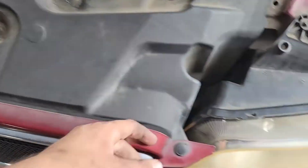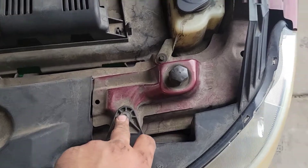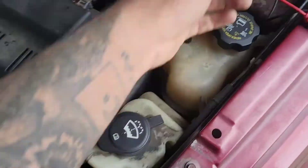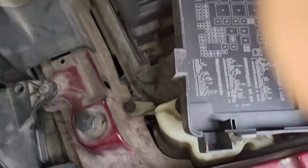In order to access the headlight housing, you've got to take out this push pin, that push pin, and that push pin so you can flex the grille. There is a 10 millimeter bolt right there and two 7 millimeters — one right here and one right there. The whole headlight housing does come out. We checked the bulb, but that wasn't the issue.